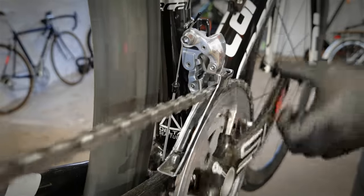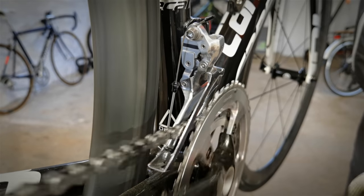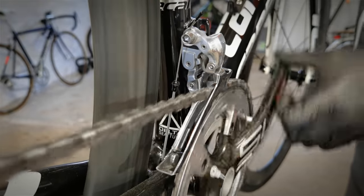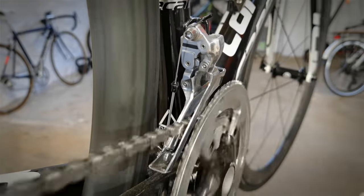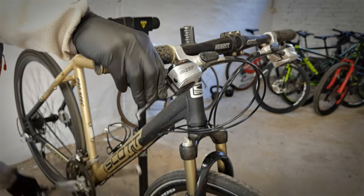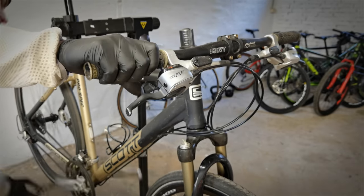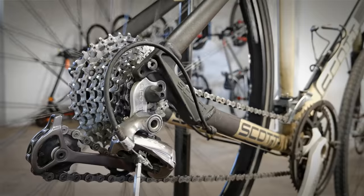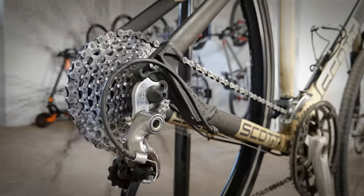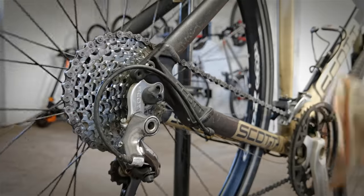The best test is trimming: trimming down, shifting down, trimming up, shifting up, trimming down, down, shifting down. If the trimming works, you have done your work properly. Now for the weirdest MTB shifting system — the Shimano Dual Control. Somehow people did not want it so it's no longer available, but it really shifts well. The weird thing about the low-normal derailleur is that when you release the cable, it shifts to the lowest gear, not the highest.